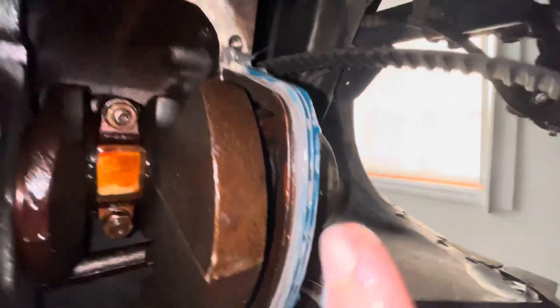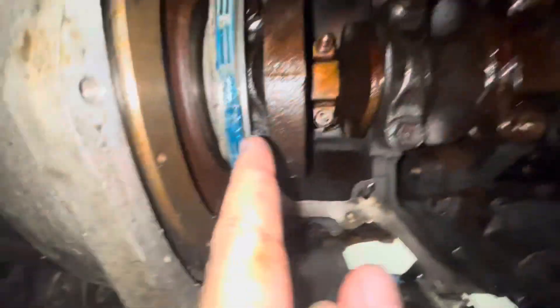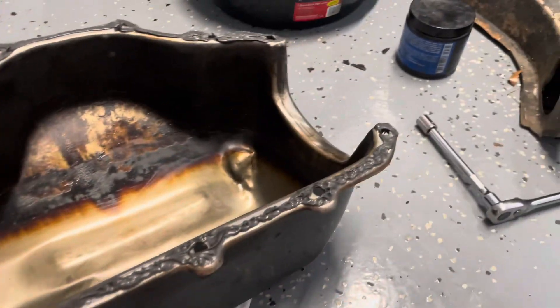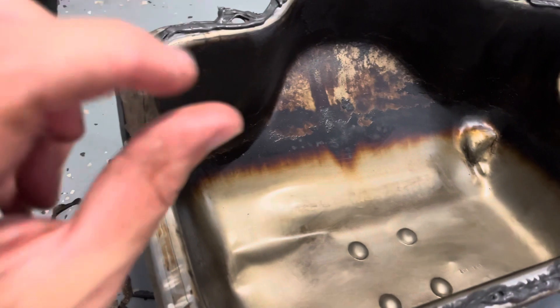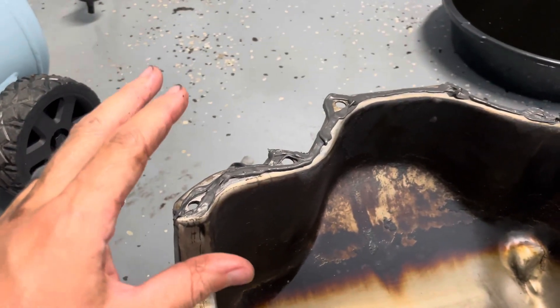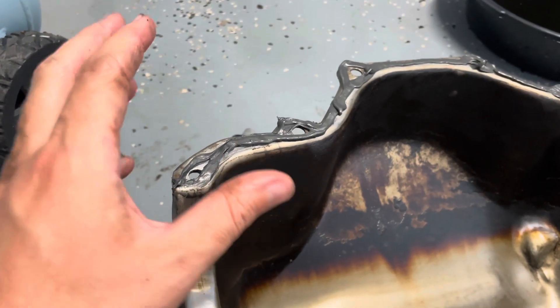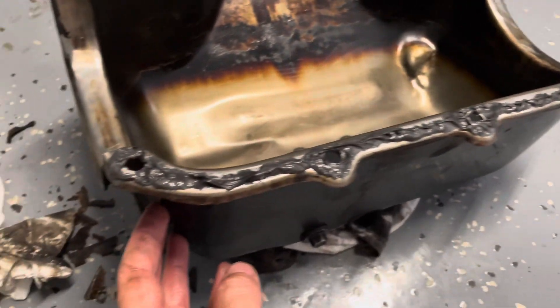A couple things I did to prepare: for the rubber seals I did a little quarter-inch bead of RTV where it's gonna meet the pan on the edges, then I ran some grease through them to help them seal. On the oil pan side we had a little bit of sludge in the bottom so we cleaned it out — not a lot, just a normal slight film. The gaskets for this engine are made out of cork. I don't love cork gaskets — they seem to saturate and then seep. So we're going with RTV — a nice bead ran all the way around the gasket — and up she goes.